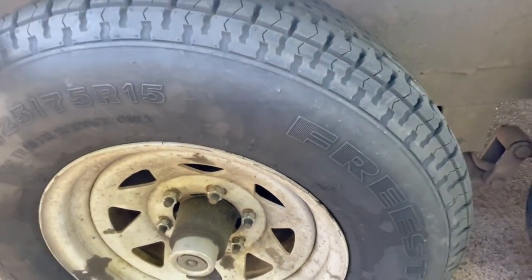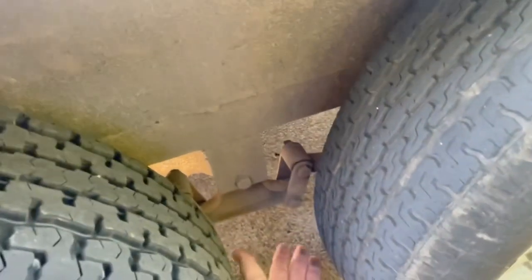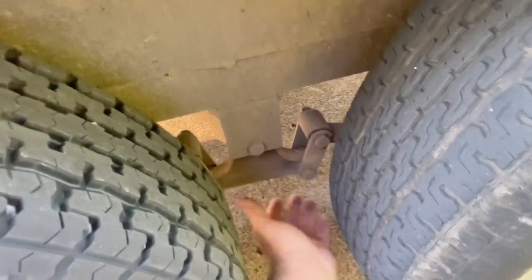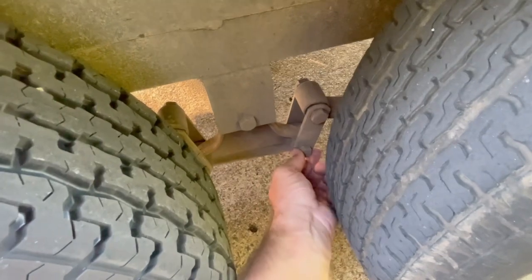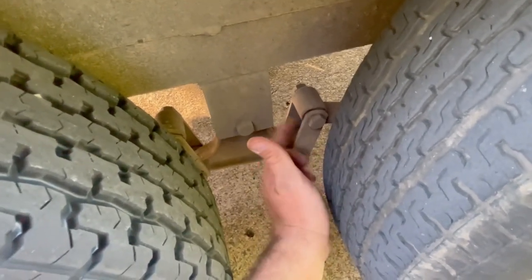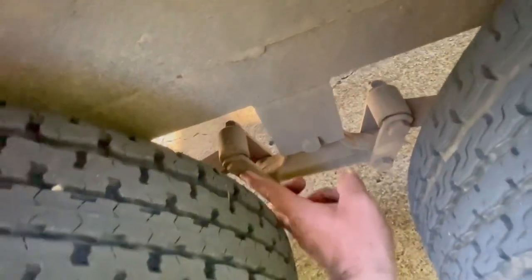What I realized when I went in and they took off the old tire and put on the new one — obviously I can't show it now because it's fully loaded and heavy and the tires are back on — but when it was jacked up, these right here were all pretty loose. There's just a lot of wiggle room and there shouldn't be any wiggle room. These should be super tight. And these are connected to the leaf springs over here.